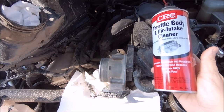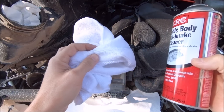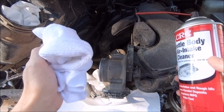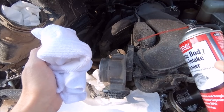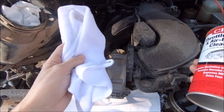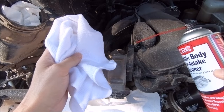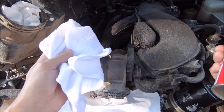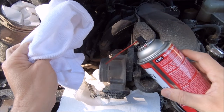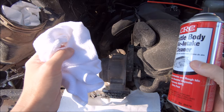Now for the cleaning part, I will be using the same throttle body cleaner to hit the backside of the metal housing, and I'm going to spray the throttle body cleaner on a microfiber towel to wipe from the inside of the plastic housing on the right of the throttle body. The less of this stuff you get further into your intake, the easier it will be to start your truck for the first time. This is a white microfiber towel - you'll see just how filthy it gets. Don't use paper towels in here because if any piece falls off and gets sucked in there, that's not going to be good for your engine. I'll do a time lapse so you can see just how nasty the cloth gets. I already cleaned the outside and inside with a toothbrush, so it was cleaner than it was - but I'm betting it's still going to be pretty filthy.